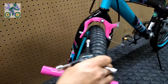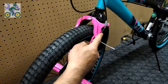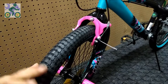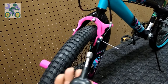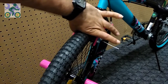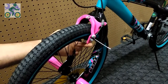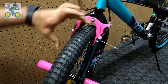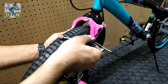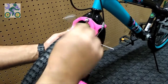For the next step we need to adjust the cable anchor bolt. This anchor bolt is used to hold the brake cable. First, hold both brake arms from inside the rim using the two-finger technique. Loosen the nut with the 10 millimeter wrench — here I use my own three-way tool. When the nut is loosened, push the brake arm in with your finger.